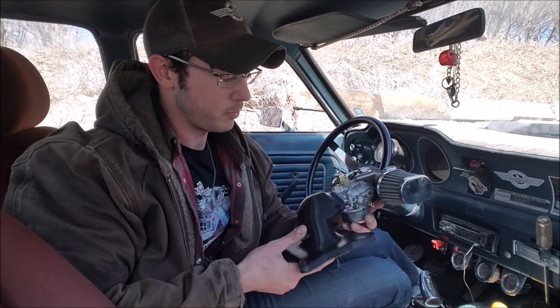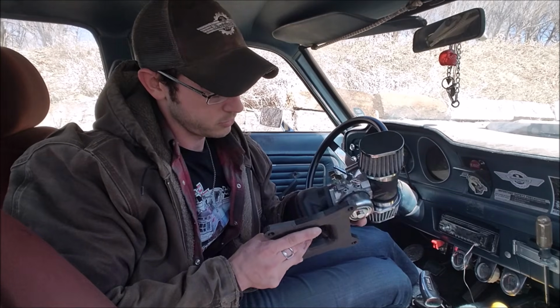No accelerator pump, but, you know, there's been carbs throughout the years, like a 240 inline 6 F100. The Carter carb on that thing also doesn't have an accelerator pump. So you just flip the choke, crank it over, it fires, and you open the choke, and it's running. So that'll probably apply here as well.